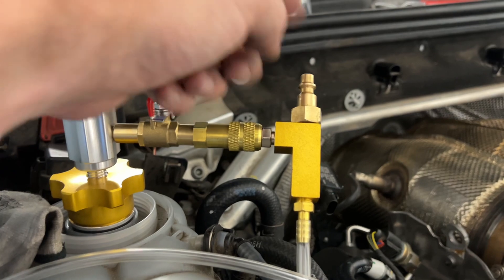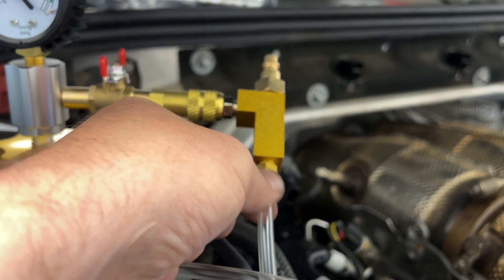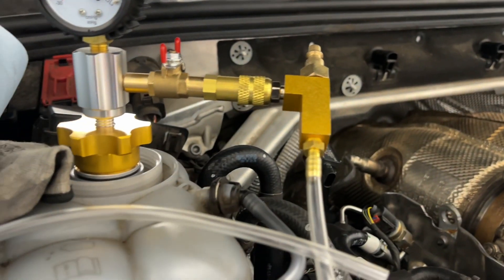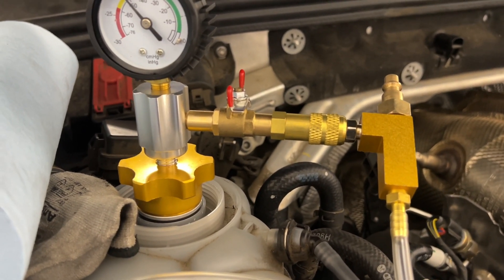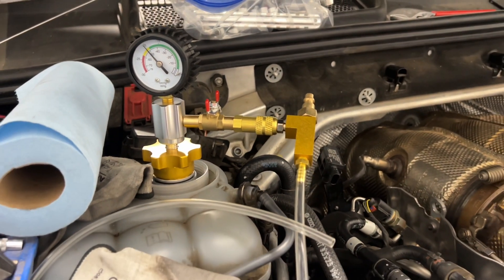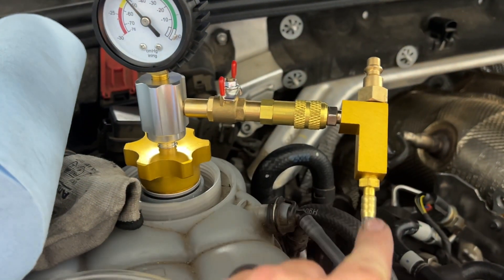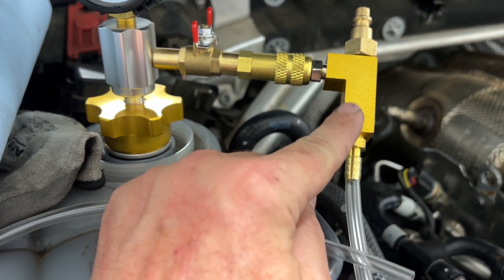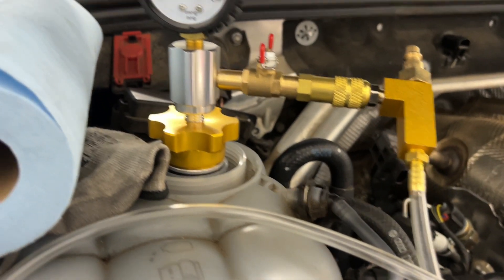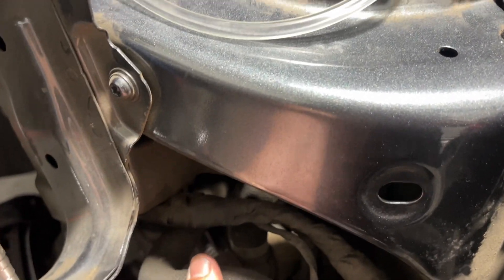You've got this block here that you feed compressed air into, which hooks up to this fitting here. Compressed air comes out through this block at a very high rate of speed, and then it exits here and utilizes what's known as Bernoulli's principle in order to suck air out of the coolant system, so that you can actually pull a vacuum on the system itself. Because the air goes so fast through a small restriction, it actually pulls air through the tube and sends it out the other way, creating a vacuum. This allows us to check and make sure that we've got all of our coolant hoses hooked up correctly.